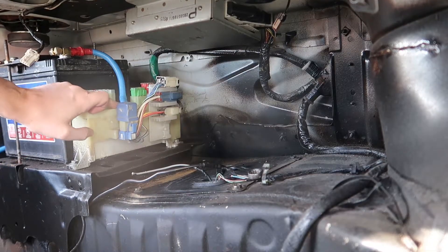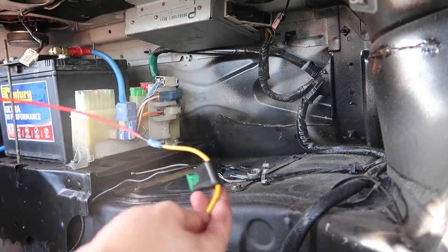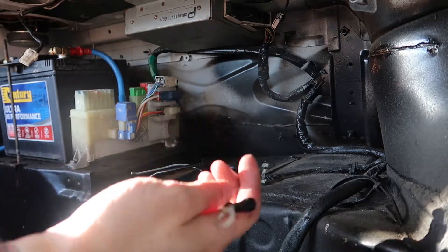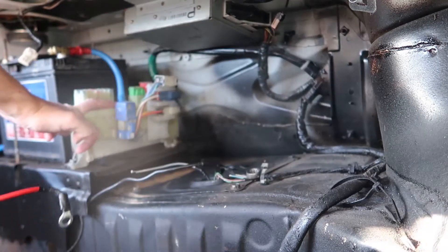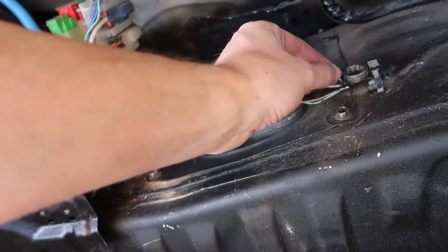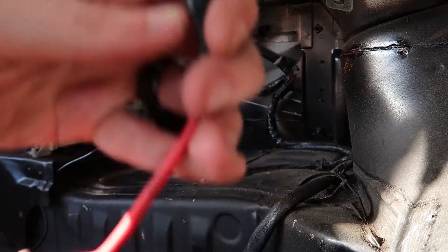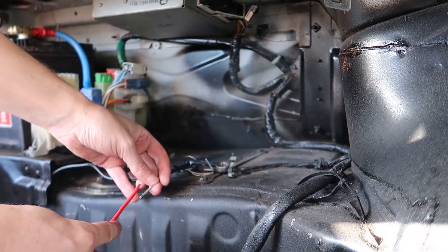For the power, I'm running a cable directly from the battery terminal down to where the relay will be. I've got a cable here with a 30 amp fuse in it, with a spade connector and a loop connector that goes on the battery side. We'll hook that on last because you don't want a live wire flapping about. The remaining wires are the signal from the ECU and the wire to the fuel pump - these will use spade connectors to connect onto the relay.